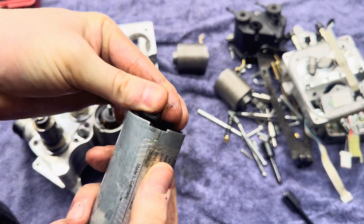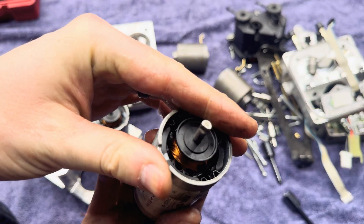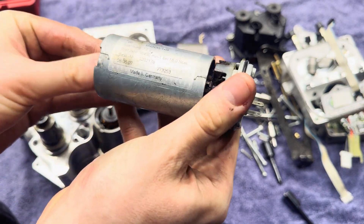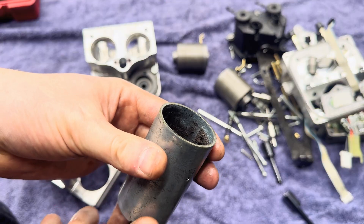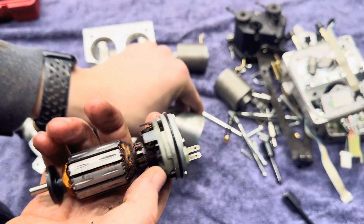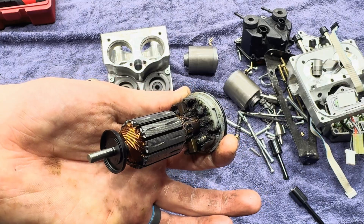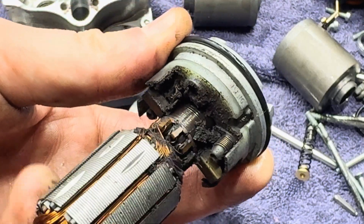This is just a little electric motor. Doesn't smell too burned, but that's what we're working with there. I bet you that right there is why this pump failed — look at all that debris in there, all that garbage. The brushes right there are just totally gone.